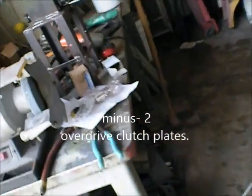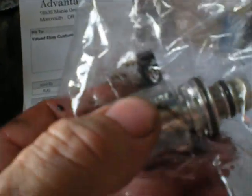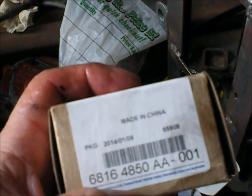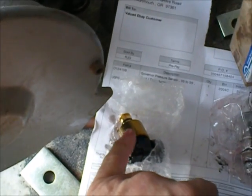Here are the parts you'll need. I got these from electricaladvantage.net on eBay. This is the new gold-colored transducer, $66. This is the new heavy duty BorgWarner solenoid — it's about twice the size of the factory one and it's guaranteed not to leak, which is what makes the original factory ones fail. That's a BorgWarner part number 22958HDSL. This transducer is for 2000 and up, which I ordered by mistake, but the solenoid will work. The transducer and solenoid together was $86, and this one was $66.